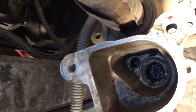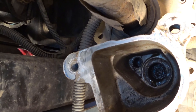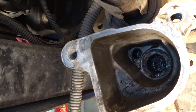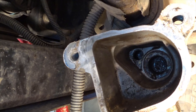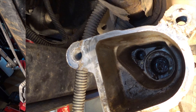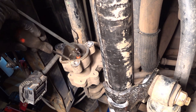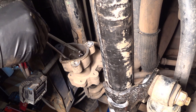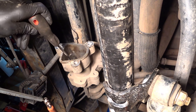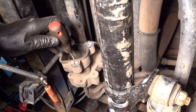Inside the actuator there is the larger diameter circle. I'm going to take the supplied washer that's zip tied to one of the mounting bolts or mounting holes. I'm going to use a magnet and put the washer flat down into that little cylinder there. We're going to change it and use a screwdriver. There we go — it's the hardest part of the whole thing.